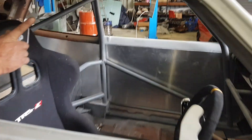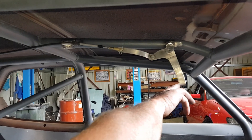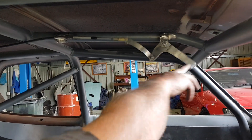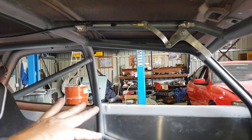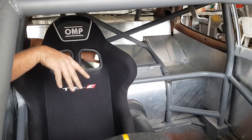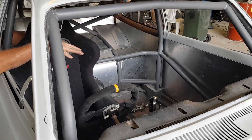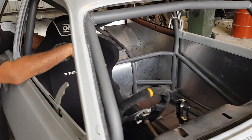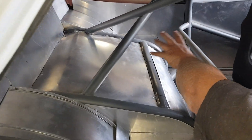The other thing we've been doing — we've got the chute cable, that's all mounted up and got a nice swivel there so the cable doesn't feel too much angle. That's all come out really good. The tin work is all just dummied up in place with a couple of rivets to hold it. Now we're going to tear it all out and continue all the bead rolling right throughout the car — we just had to get it in there to get all the bracketry mounted up and in place. When it's all riveted down it'll be nice and tight and a couple of those bends tuck under the tubs so it will be quite neat.